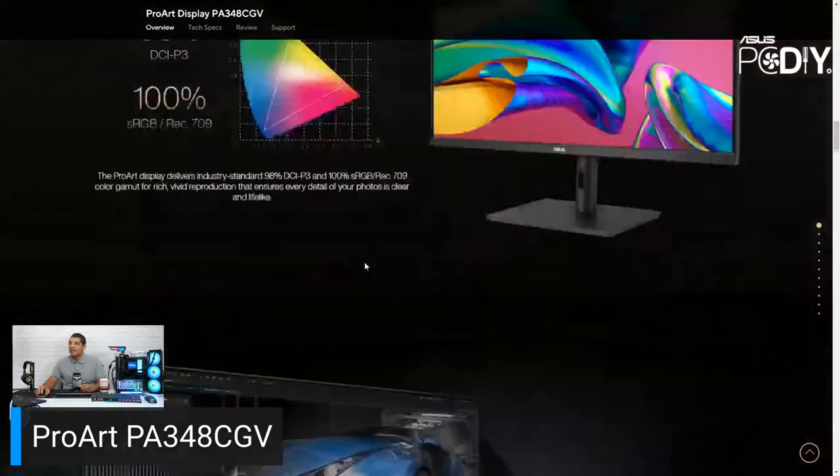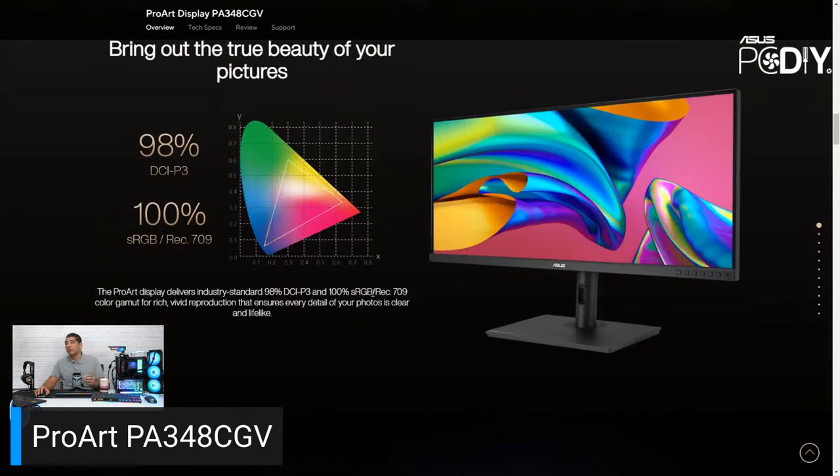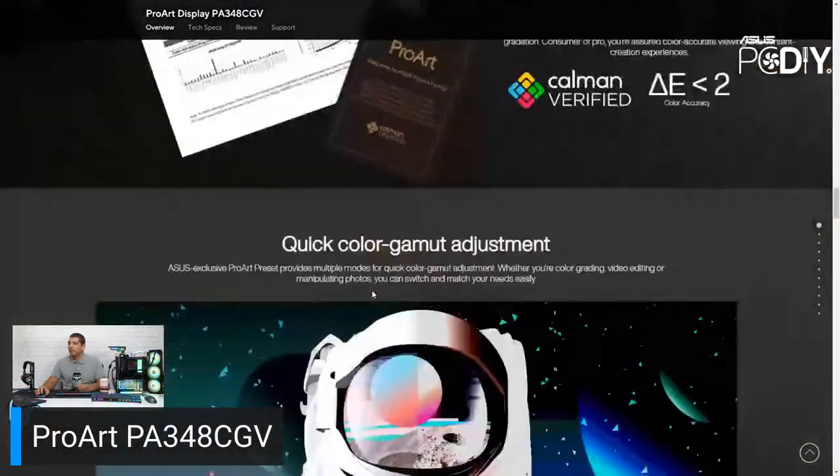Of course, that outstanding color coverage. This also does have outstanding options for calibration. A lot of people forget that with a basic monitor, you may be able to color calibrate it to a good standard, but it might not offer you, let's say, 6 color axis control and independent gamma adjustment, where on a professional display, we do give you 6 color axis and independent gamma. On a traditional monitor, it might only be a 3 color axis adjustment, right? So that's some of the differences that you have available to you.